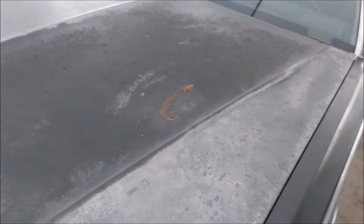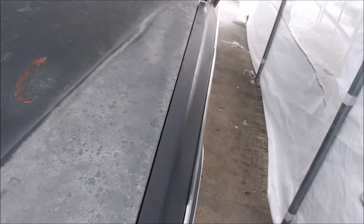I'm kind of leaning more towards the 350 because I know that's a direct swap for the 305, because it's practically the same engine. This 305 has slightly smaller cylinders. A 5.3 liter will bolt to the transmission, I know for sure, but I'm not sure the motor mounts are the same. And the swap kit for a 5.3 liter or any type of LS really is like $400, and the 350 I can get for $400, stock 350 block at least.